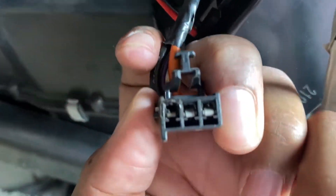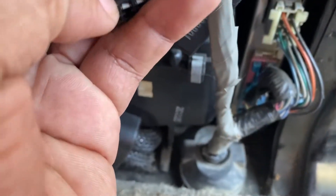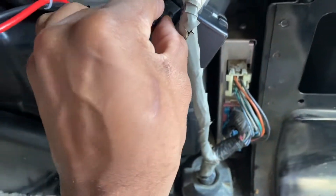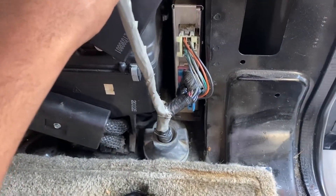So I saw this issue right here. As you can see, that third prong all the way to the left is kind of melted. So I thought that might have been the issue. But I went ahead and plugged that into — this is a resistor for a Jeep, so it came with the wrong plug that goes into the blower.